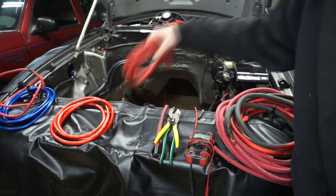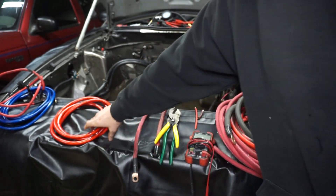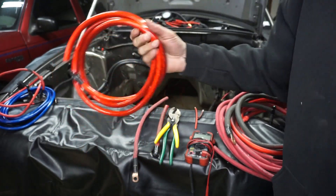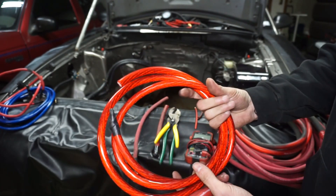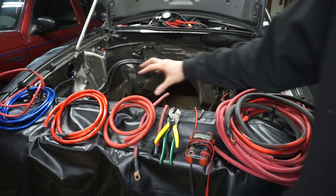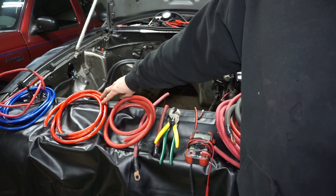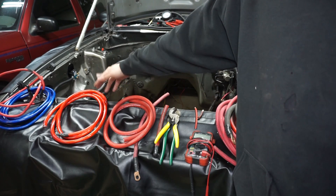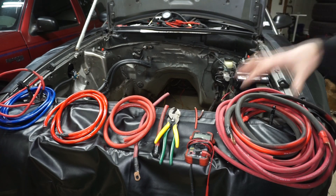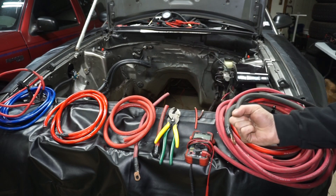This is a New Concepts OFC copper wire, which is actually pretty heavy compared to something like this zero gauge aluminum wire — this stuff is pretty light. So this copper wire is going to carry a lot bigger load, but you're going to pay a lot less for the aluminum. I really think for some people it's like a psychological thing — they see a big wire and think they're covered just because it's big, even though it's not going to carry as much as they need. This might carry like 150 amps, and people will put a big amp on it and try to pull like 300 amps through it and not have very good luck with that. In some situations, it's better to just pay for the copper wire because you can carry the same load with a much smaller diameter wire.